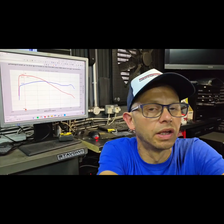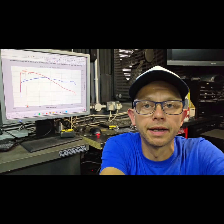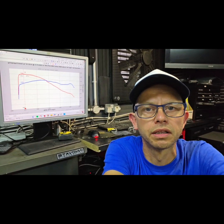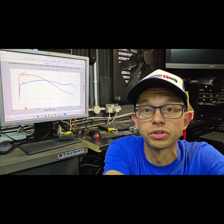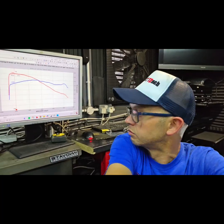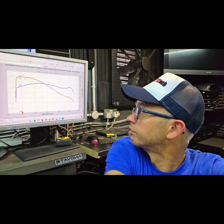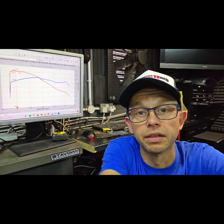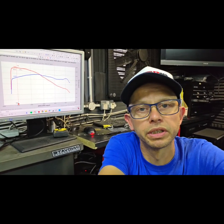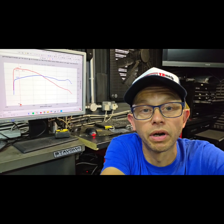So there we have it — a cracking little engine, really revvy. I do like tuning these, they sound fantastic as you heard on the video. We've got the graph behind us and it's done really, really well — really impressed. I think these are about 116 brake horsepower standard in the large port early form. This one's just done 140 brake horsepower, which is absolutely cracking. 120 foot-pounds of torque, revving to a bit over 7,000 RPM. I've set the limiter at 7.5 to keep it safe — 7.3 with a soft cut. So 140 brake horsepower on our ZX6R carb kit and Nodiz. I've set and tuned the ignition on the Nodiz, and we've rejetted the carbs on the dyno to get it to where it is now. Absolutely cracking little engine.